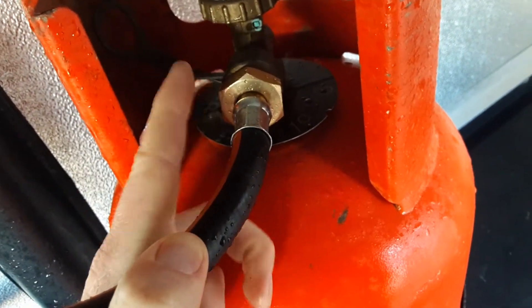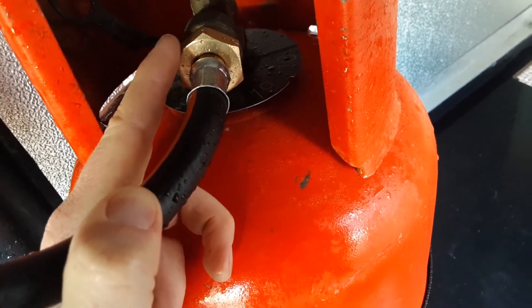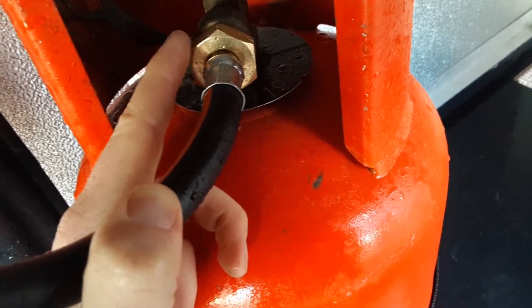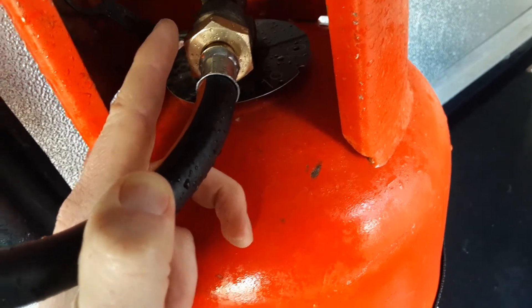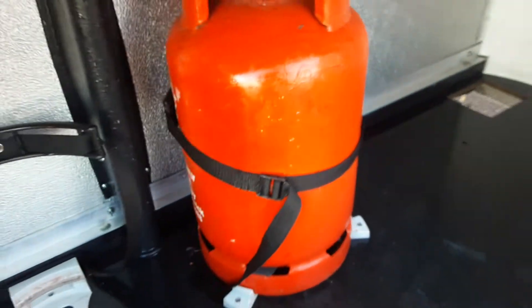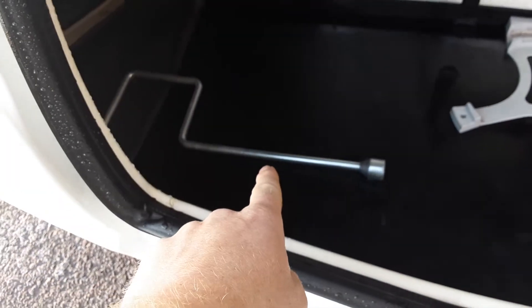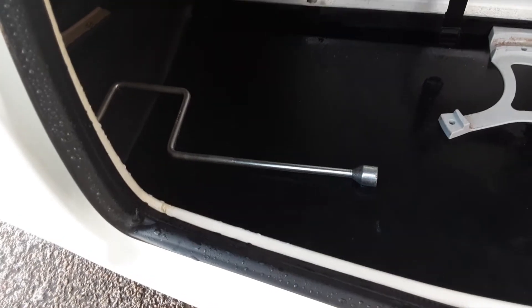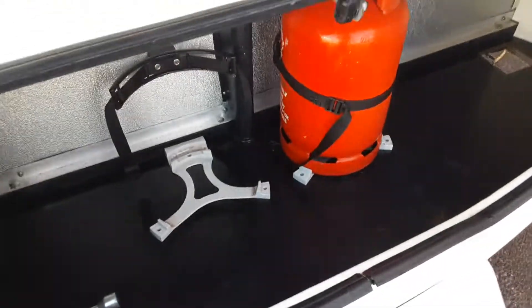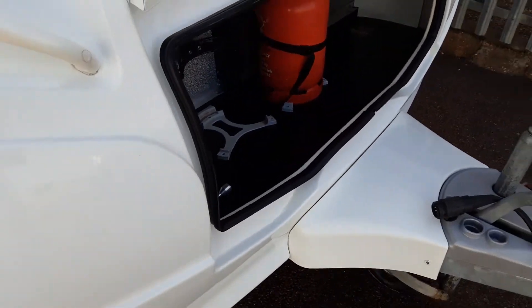In the front of the bottle you've got a reverse thread fitment. You need to turn this pipework the opposite way to a standard bottle lid to release the fitting from the van — it is a reverse thread fitting going into the top of the bottle. In the front locker you've also got your leg winder to stabilise the caravan while you're on site, and you can carry a maximum of two 6kg propane gas bottles in this locker at any time.